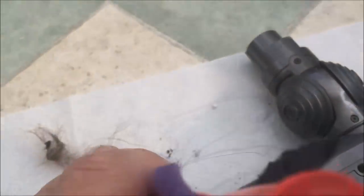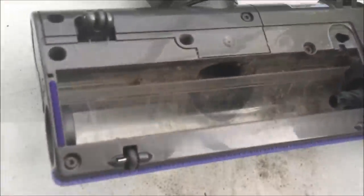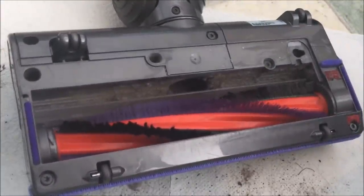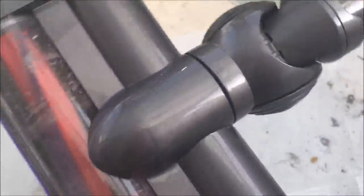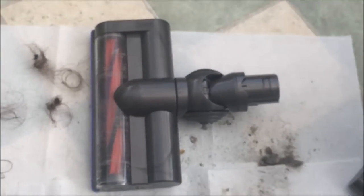So that's what was trapped there. Check this end bit as well from the blade to make sure you've got all that off, then you're ready to slot it back in. This end here goes onto the motor. That's got it back in all nice and clean, locked with the one-cent or one-pence coin. Just need to put the main cover back now — then the head is all ready for another three or four months. Clip that cover back on and re-lock it with the coin. Give it a last little tap and make sure there's nothing else in the tube. Your head with the carbon fibre filaments is all ready for action — just re-attach that to the main body of the Dyson.